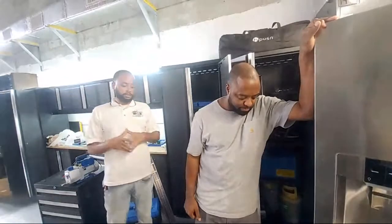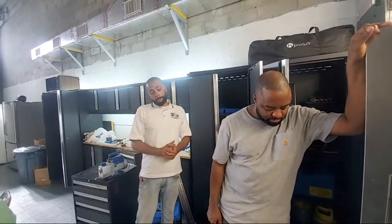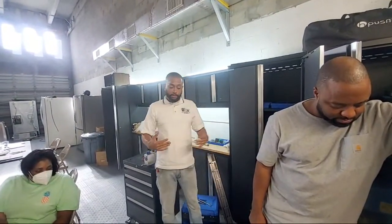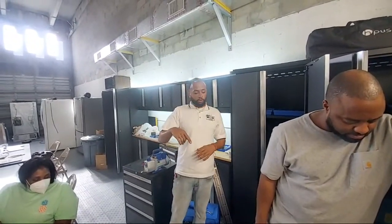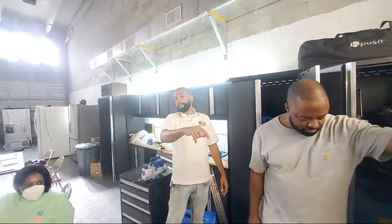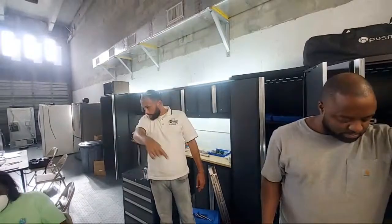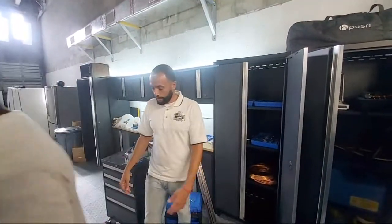Now that we've verified input voltage, we gotta verify that the board is distributing to its loads, i.e., motor, element, compressor, whatever. We want to check components from the board. So this group, y'all tested, right? And y'all did the schematics. Now y'all gonna flip it and we're gonna do the heater element. Y'all gonna locate the heater element and do the measurements of it. Now follow me while I show y'all how to locate that.